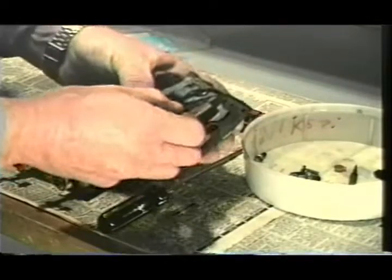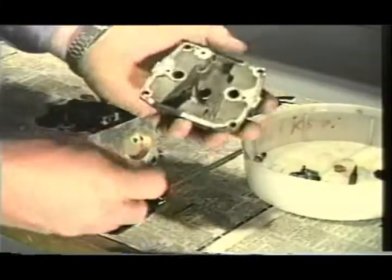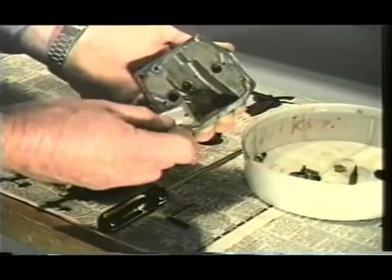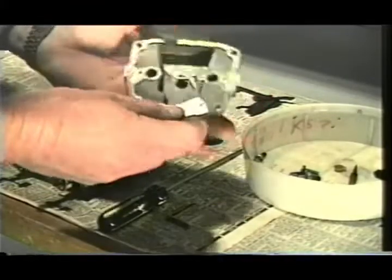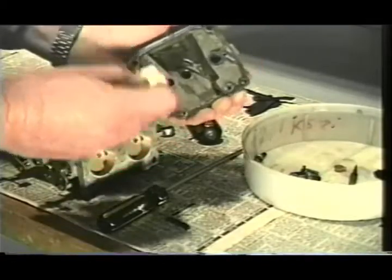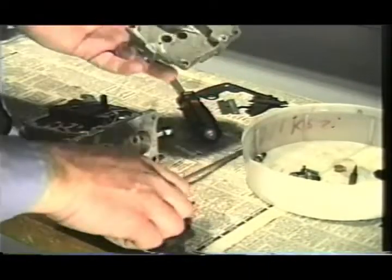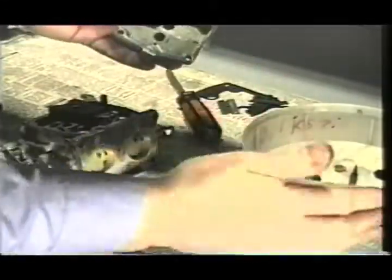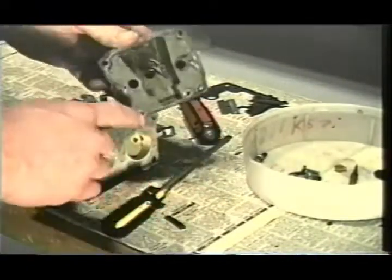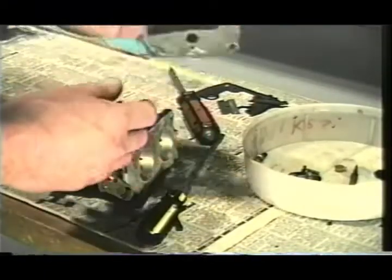We'll pull our old gasket off. Before we put anything in carburetor cleaner at all, let's make sure we have all this gasket clean. Take your razor blade, be very careful not to cut yourself or dig into the carburetor base itself, and clean off any remaining gasket deposits. Now we can see all that deposit that just came out of the carburetor — this is why this carburetor is not functioning right now. During a high-speed situation, this carburetor on a particular outboard would not function correctly.